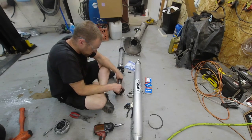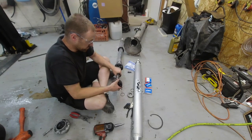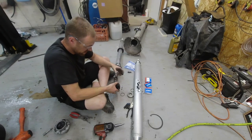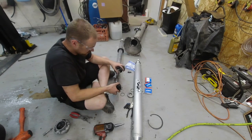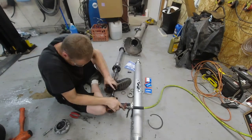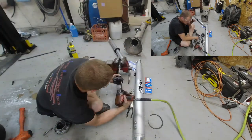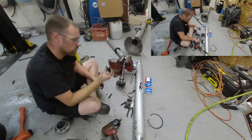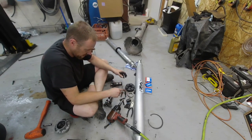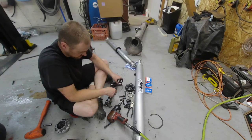I've always been able to get them from this side, but this one I can't even get it with being straight on without any crazy adapters. I decided to try flipping it — and sure enough, the input and output are the same. I think the issue was weight: when hitting the impact, it was just absorbing all the vibration. By adding more weight, the momentum of the impact gun does a lot more work. That was way tighter than anticipated — definitely the tightest one I've had. I busted my bit, sheared it off with a snappy bit. The second bit finally got it off.